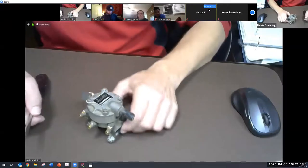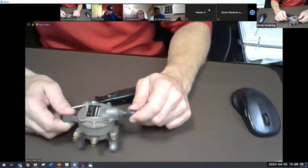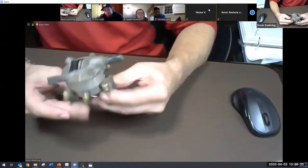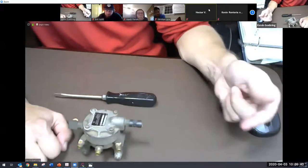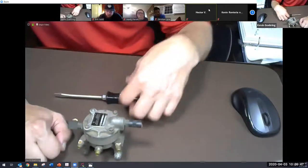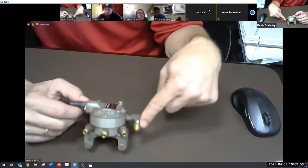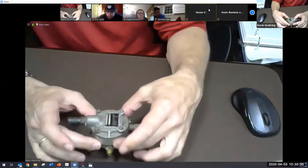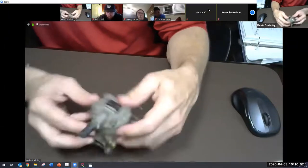Okay, here's the distributor valve, here's the vent. What bugs me is that you can't really read 'vent' on my screen — I need my HD camera. You can see the bolts that would go through the spine of the back of the engine on top. You'd never want this vent facing forward because if ram air comes in and pressurizes the top, it would assist the spring pushing down on the diaphragm.